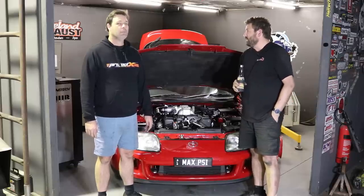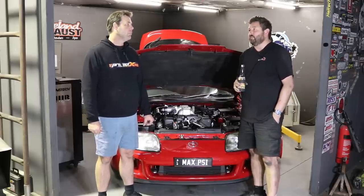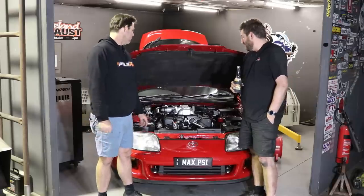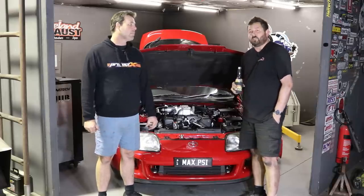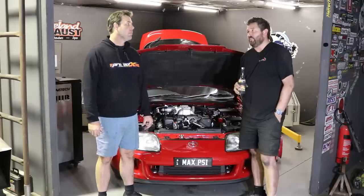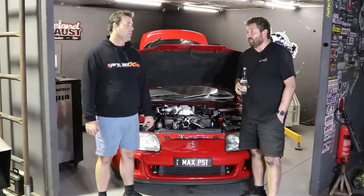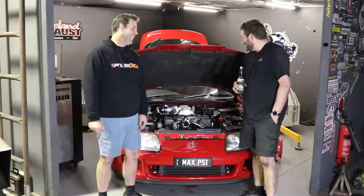So there's no reason why that thing won't go 1,000 horsepower at 8,500 revs. With more injector, and MAP sensor stuff. I kind of limited myself to those injectors at the start because the gearbox has a standard V8 planetary in it, and even if it was going to make more than that, I wasn't going to.